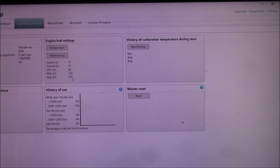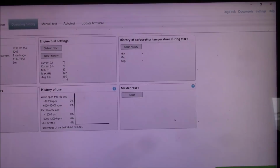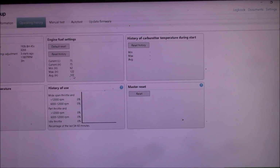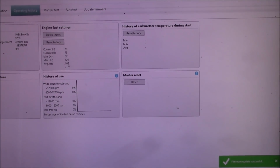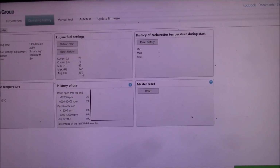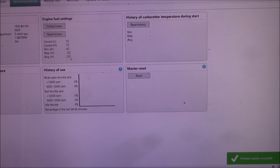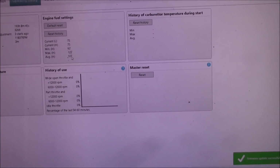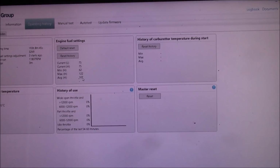Under load, it'll do that lean out test where it'll hold that valve closed for a couple revolutions, and there's a pool of fuel in the carburetor, and it begins to lean out some. Now, if that saw picks up RPMs as that mixture is beginning to lean out, that means the mixture was too rich, right? If that saw slows down as that mixture begins to lean out, that means that saw was too lean. And the Autotune will make a slight adjustment to try to correct based on what it found during that lean out test. It is always shooting to get that saw to max RPMs, which is effectively max power. It's like if you're on that saw with a screwdriver while it's in a cut, trying to adjust the mixture to get maximum power every couple of seconds. That's what's going on with that saw. Actually, every split second.